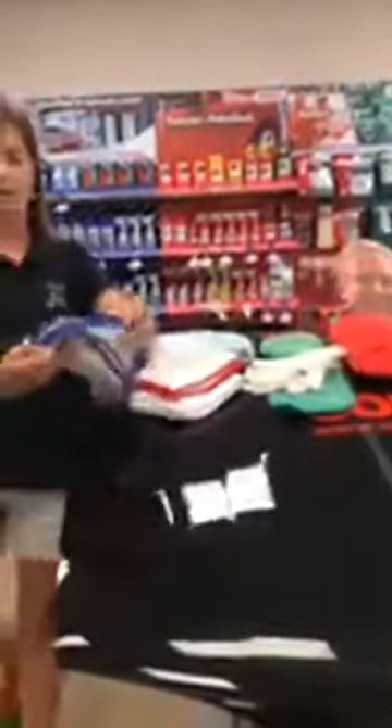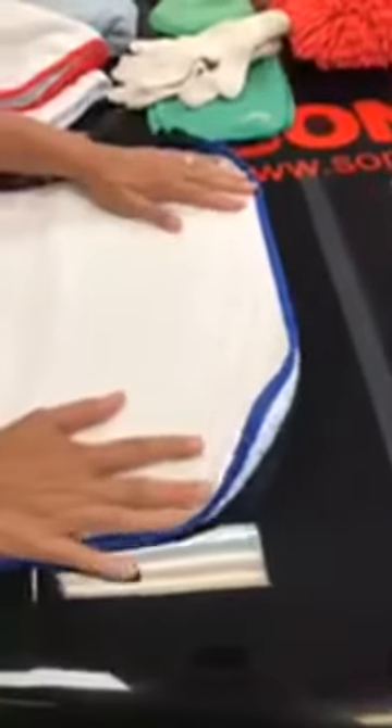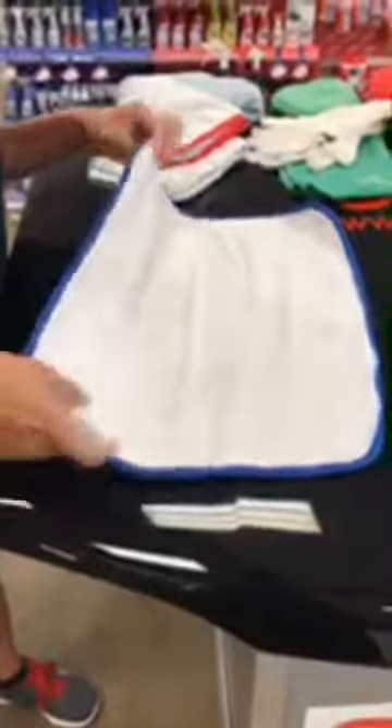You hear Mike Phillips talk about this a lot — you want to do a microfiber inspection. You take your microfiber and lay it out on the hood of your car, then run your hands across it like this. You want to make sure there's nothing caught in the microfiber that you can't see, because you can really feel everything. Once you check one side, flip it over and check the other side. You just want to make sure there's nothing in there that's going to scratch your paint.